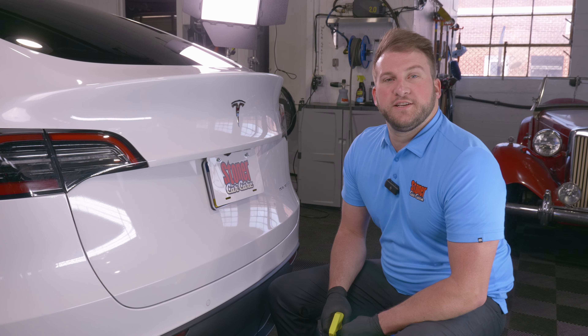We're going to start off by spraying it down with Center Car Care's odor-free iron remover. I spray this on here and we're going to let that set up. Anytime you're doing an iron remover process, if you want to get down to a fairly clean surface, you're going to want to add clay to the process as well. This is going to be the chemical portion of it, and the clay is going to be the mechanical cleaning portion.